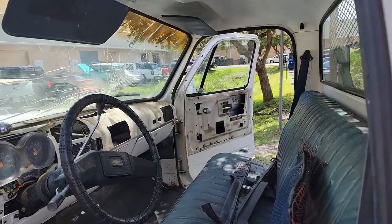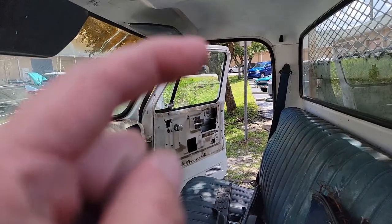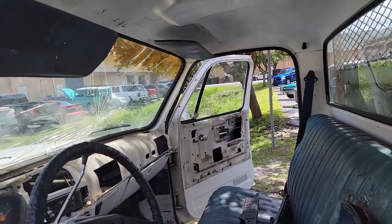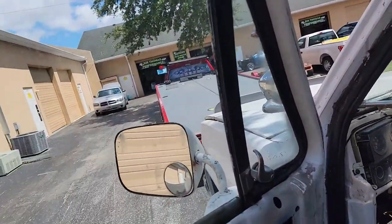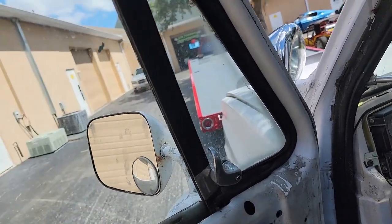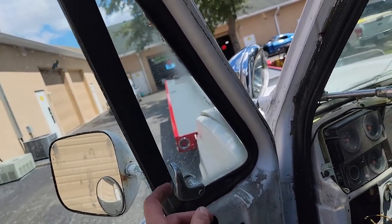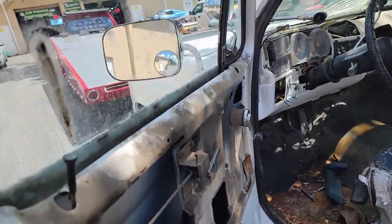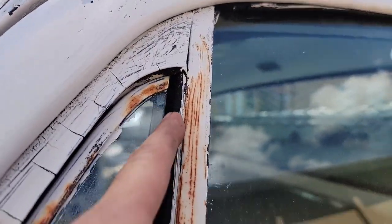Go ahead and order that new channel and clean these doors up. Got that door off, lubed it up — that one's in good shape, just had to grease the rollers. On the other side, all the rubber and felt is just distorted and holding the glass back, so I busted a few pieces out and the window goes up and down nice now. I'll have to put all-new felt around it, which was the plan. I want to look at this — I think this is a two-piece seal, not a one-piece, so I'm going to get those ordered.